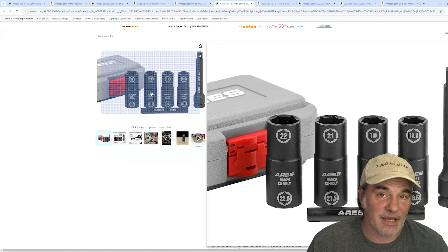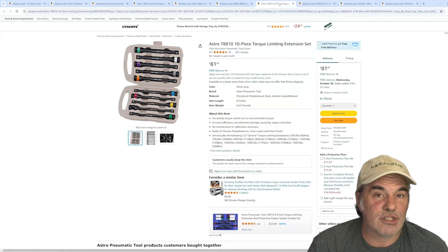Now let's talk torquing wheels. A lot of shops still believe in torque sticks, and with air impacts, torque sticks are okay. I wouldn't recommend trusting them for actual final torque — use a lighter duty stick and then use a torque wrench. Really important to note: if you go the route of an electric impact, do not use torque sticks. They don't work reliably with electric impacts. The difference in how the motors work versus air means they're not consistent, and it will cause long-term damage to your electric impact.